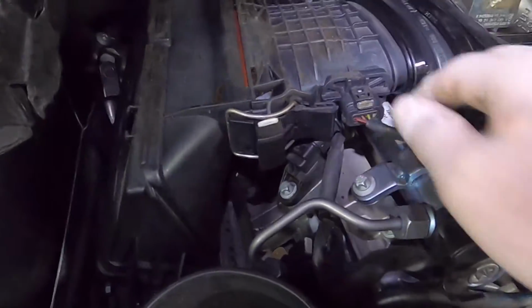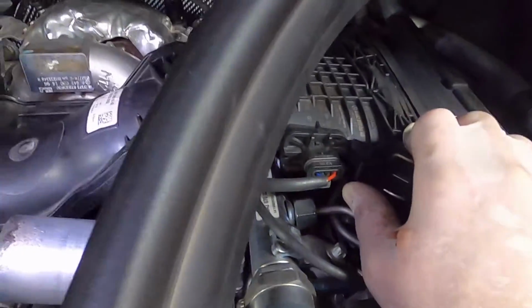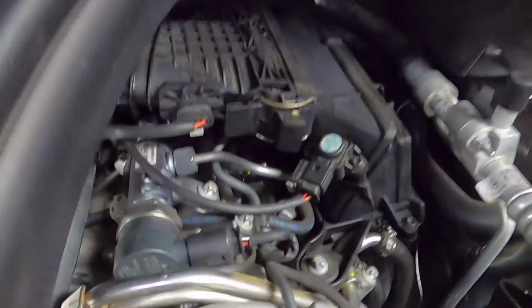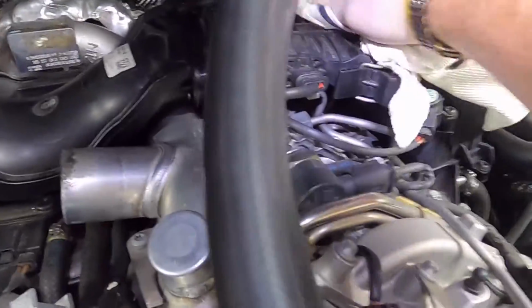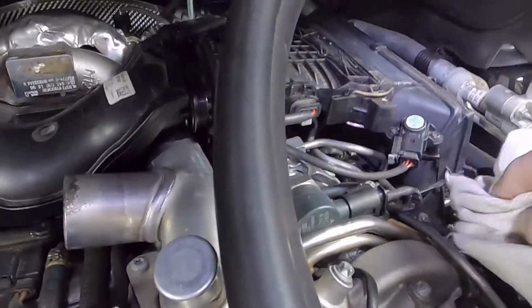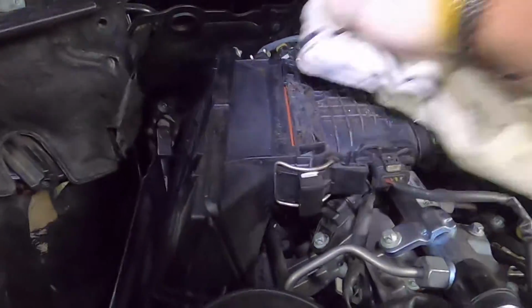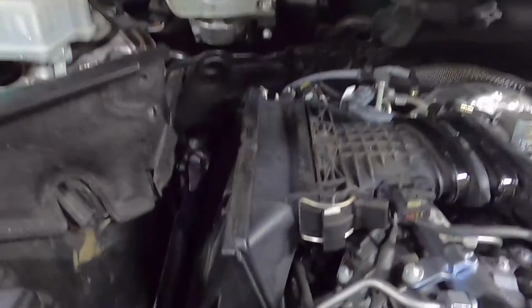So we've got these clips on. There's the air cleaner clips. Got the connectors back together for the mass sensor on that driver side and passenger side, or the left hand side, and also not forgetting the air temperature sensor on that air cleaner. It's all getting a bit gummy there. Unfortunately the engine touches the top of the cover, and that seems to be disintegrating over time, which is what all this horrible black fluff is. Can't do much about that other than taking the cover off completely.